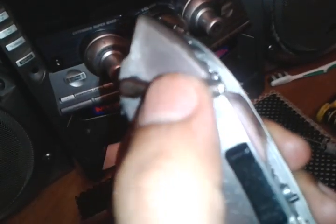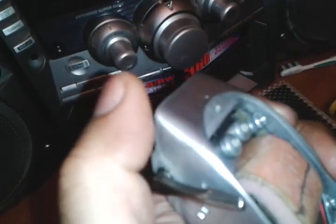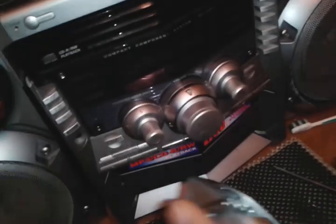While I have this cutter blade off, I also want to show you how to zero gap your Andis Master. The simplest way to do it, which I already removed, is a little guard piece that sticks up from here. You take your pliers, either needle-nose or regular pliers, bend it back or break it off, and that way you can just push the blade on up to a zero gap. But when you do this, be careful, because you don't want to push it up and let the cutter blade overlap the comb blade. So look at it as you push up before you cut a head, and you'll see that it's zero gap, because you don't want to cut anyone.